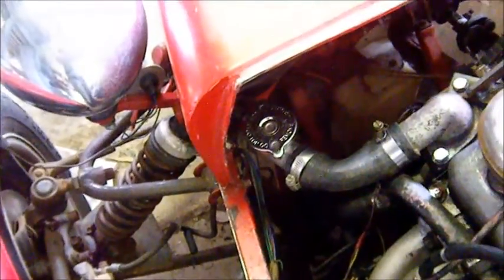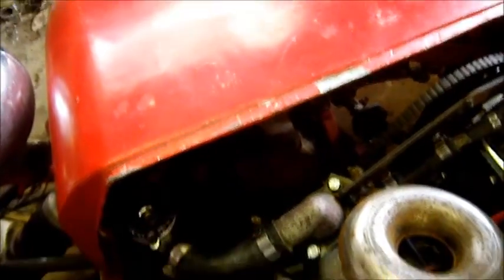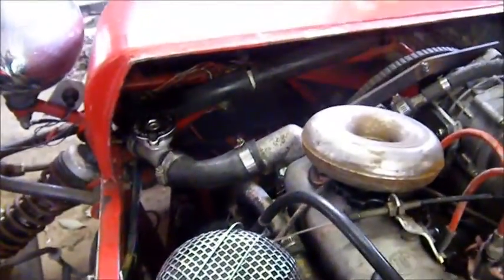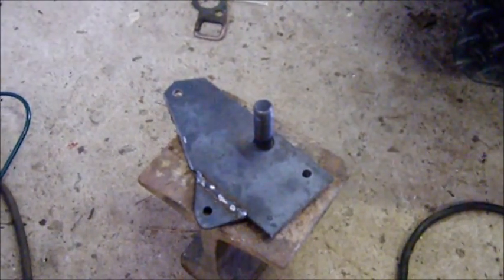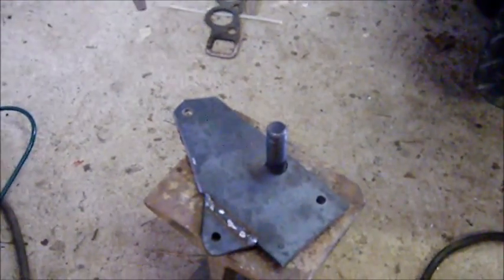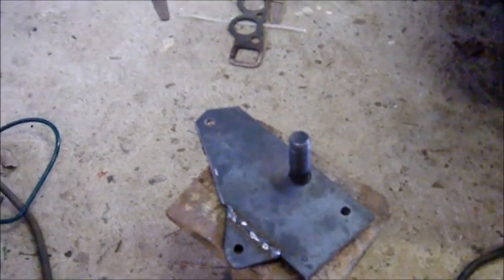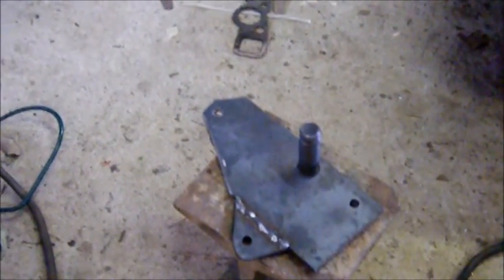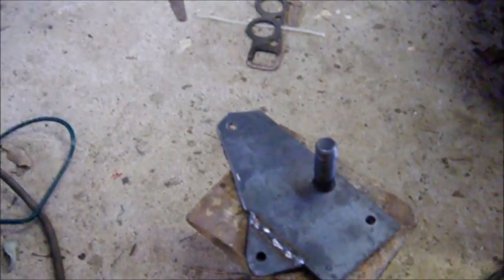It's also more convenient for filling it up — it just sort of tucks in there. Unfortunately I'm short two hose clamps so I won't be going anywhere until I get those, because I had to run the hose around the engine bay like that. There we have the front mounting plate that I've made. The big bolt that you can see up there in the middle is for a Subaru cam belt tensioner, which I'm using as a tensioner on the back of the run for the fan belt. I need to do that otherwise it's going to hit the timing mark cover on the front of the motor.